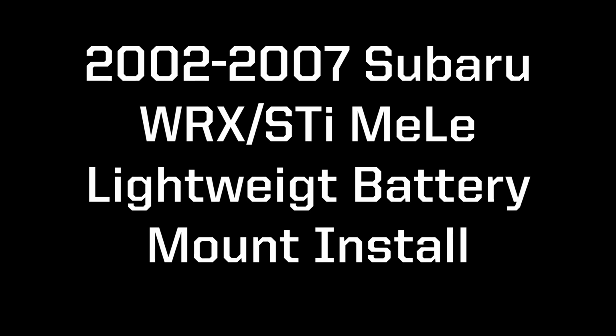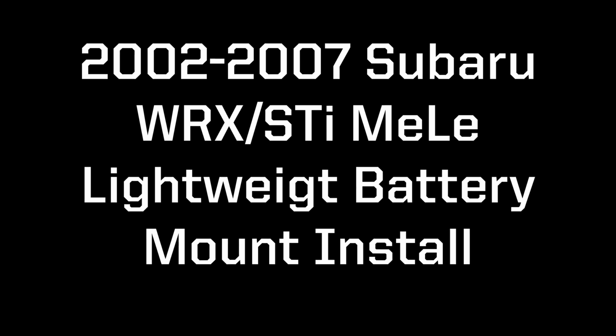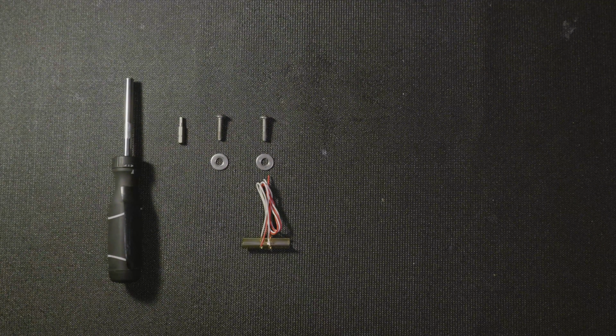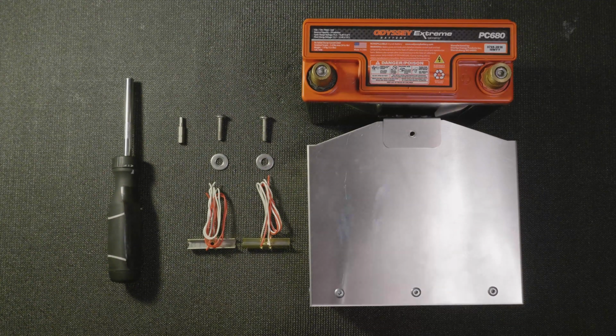This video will guide you through the installation of the MeLe Design Firm lightweight battery mount for the Subaru GD chassis from years 2002 to 2007. For this install, you'll need the following: ratcheting bit driver, 4mm bit or Allen key, supplied 4mm bolts, washers, toggle anchors with the pre-attached guide wires, MeLe Design Firm battery mount, and your battery.